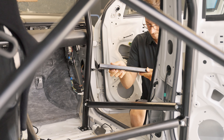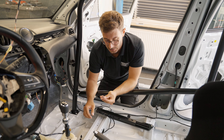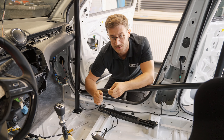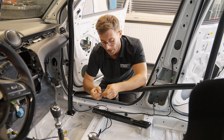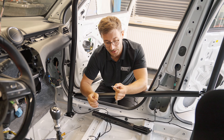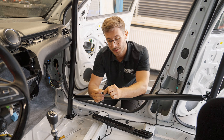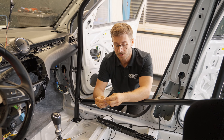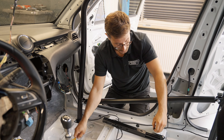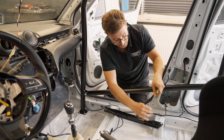I just assembled the front side of the slider and am moving it to the front to assemble the rear. We use these little custom plates — why? Because the slider always has a low thickness, around 1mm steel, and it doesn't matter if you buy Sparco, Recaro, or OMP — it's always around 1mm steel with only 4 connection points. The custom little plates reduce the surface pressure, giving us more stability and more safety. This is why you will always get those little plates if you order a complete seat mount kit from us, which we have for various cars — not only the Swift but also for every type of BMW, Hyundai, and others.